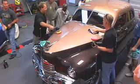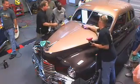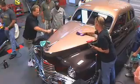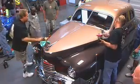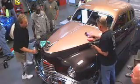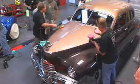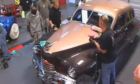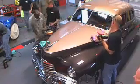And you've got plenty of wax. Here's a way to tell. Dab it down. Do you see wax on the glass? You still have plenty on the pad, so just keep on going. You can spot check yourself as you're working around the car. But the key thing, if you want to spot check off of a window glass, is you want to make sure that window glass is clean first. And we already wiped everything down. But that's how I would do that. So there you go. Turn it back over to you.